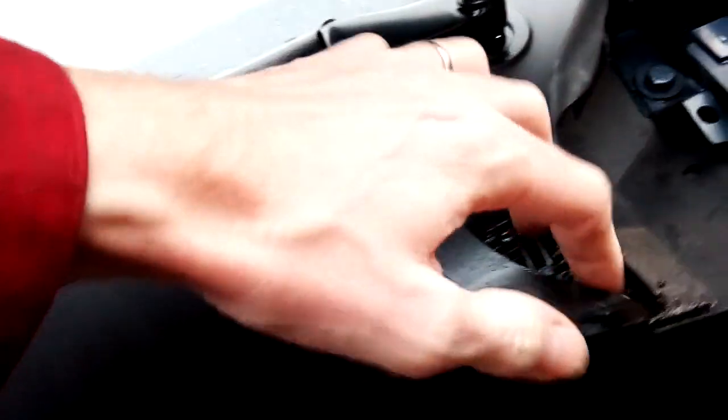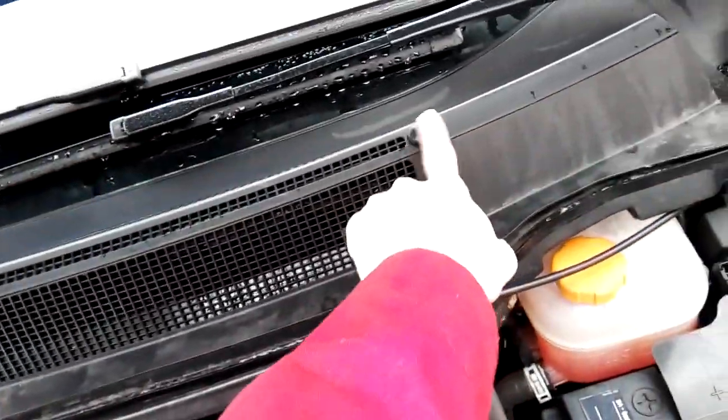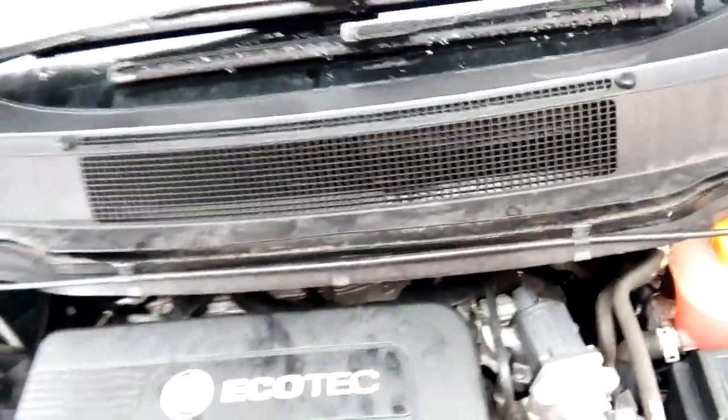So we can get down the back of the engine, we're going to take the wiper tray off. First thing, we take the rubber seal off the front like that, and you can see that now gives us a little bit of access to get underneath. First of all, we take this piece off — remember the washers are attached to it — so we need to take that off, then we can get the bolts out and get the cables and connections off underneath.